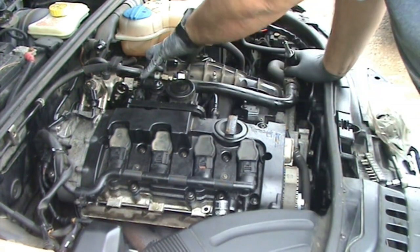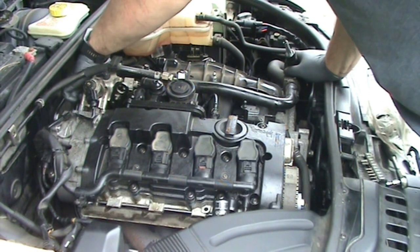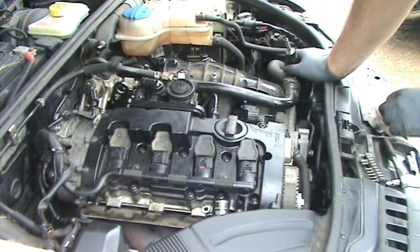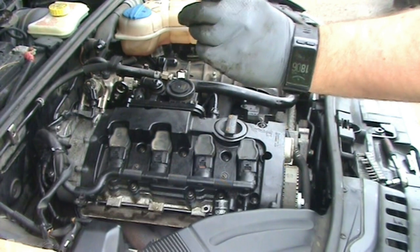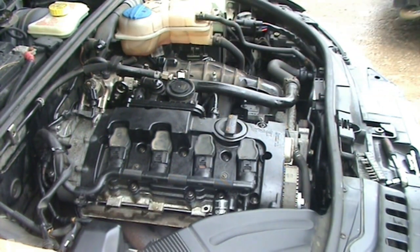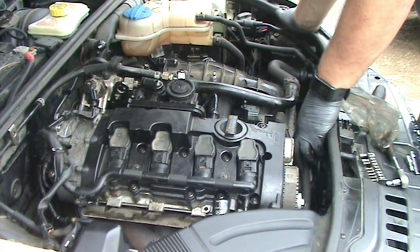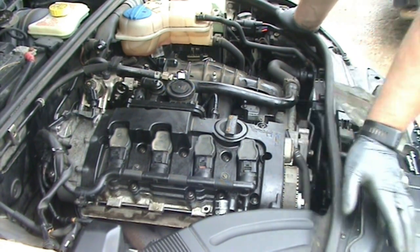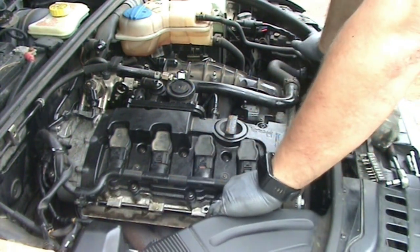Now, I need to find this hose, connect it, connect the fuel lines back here that were disconnected. Put in the fuel pump pressure relief, which is a Schrader valve. I could have just hit that. I wasn't thinking about it and I took it all the way out. Put the timing belt cover on, and then there's an electrical connector down here that I took off so I have better access to the timing cover. And then these two hoses need to get put on,